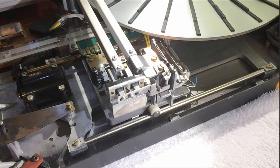This piece that sticks out holds the tonearm up, and this here is connected to the tonearm assembly. So when the plunger here goes down, then this arm here moves up and that releases this part, and then the tonearm can go down.